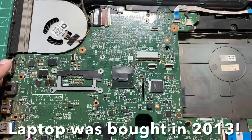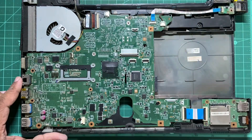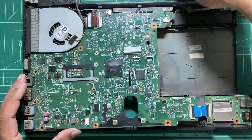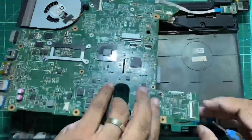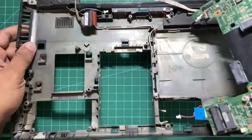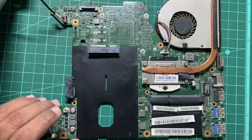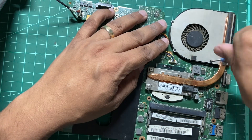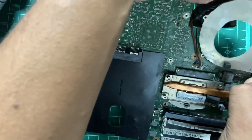Now you have the whole motherboard here — it's a miracle the board has lasted this long. Before you remove the fan, you also have to remove a few screws. There's one here and another one here. Raise this and get this ribbon cable out — this one. This ribbon cable comes off; this is your display cable. That's how you access the underside of the motherboard. This is the heatsink fan assembly for the CPU — three screws here, so we'll remove them.